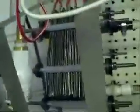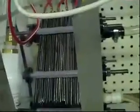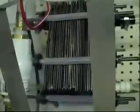And if I forget to mention that, everybody has all these little prepping techniques for their plate. Just make sure they're very clean. All I do is just soak them in vinegar and distilled water, and then wipe them with a microfiber cloth, because even a thumbprint left on the surface of the plate will stop production where your thumbprint was left. So make sure that your plates are very clean as they go in.